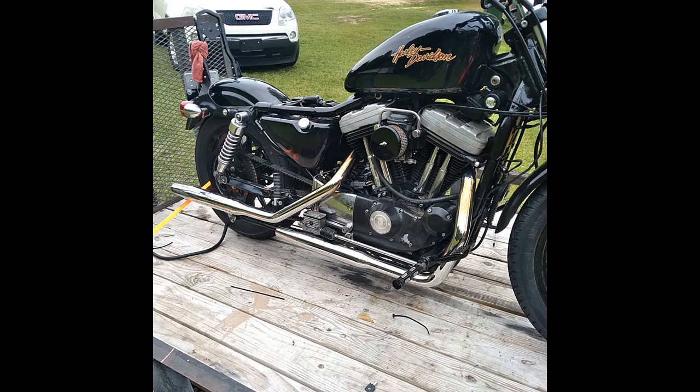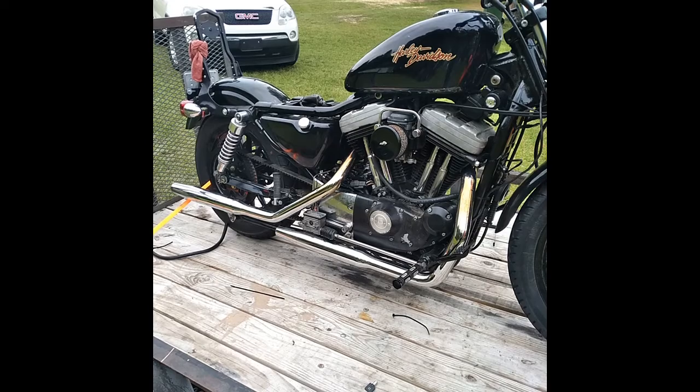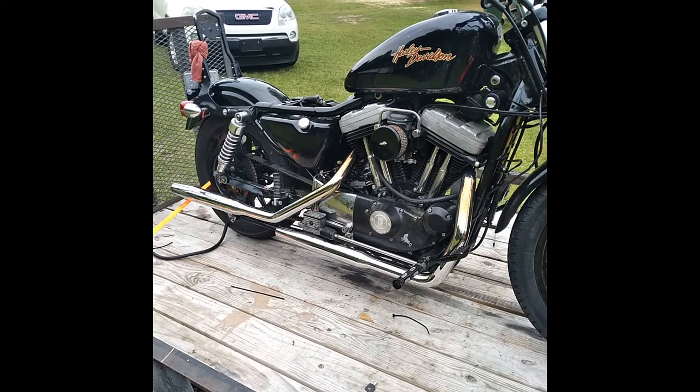So it wasn't the starter itself. The boy kept saying, 'Now I need a starter — that's going to be $300.' Well, maybe, maybe not. Like I said, somebody's been in there and put new contacts in there. Everything looked brand new. The contacts had no pock marks on them — they looked brand new, like they ain't never been used, barely made contact with anything.